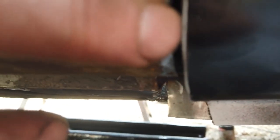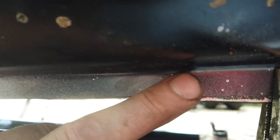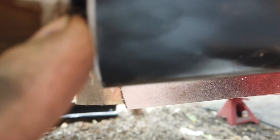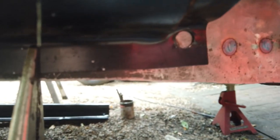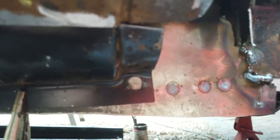I'm on that cut there and it's pretty good - following it, deviates a bit here and the gap at this end is a little wider than I hoped for. But the main one's at that top run, sitting a bit low - but you have to push it up because it's opened out here. I'm looking for an area where it's totally flush and it's totally flush there - so that's where I'll get my first tack. Three or four tacks on this to get it flush at the top, start feeding it in, then clamp it at the bottom and should be all right.